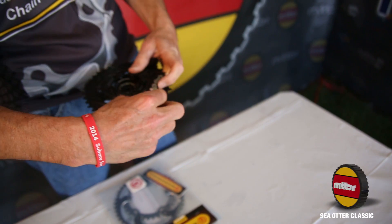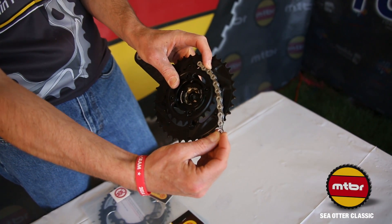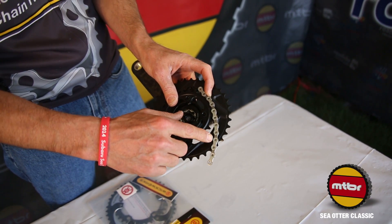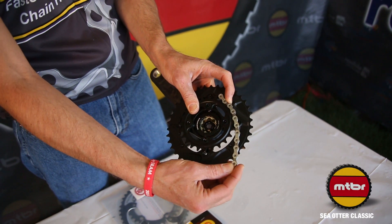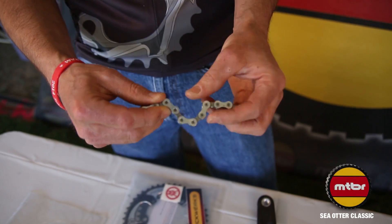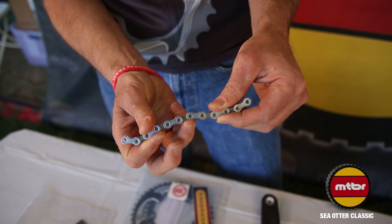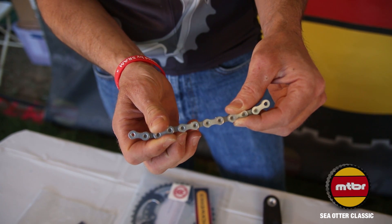Those ramps are designed with the intent to pick up the chain when you're ready to shift. So when you shift — say the chain is on the small ring — as the crank goes around, it picks up the chain on that ramp. It doesn't pick up at just one spot; it picks up at two different locations underneath the chain. So it's not like a single pin trying to catch it. We catch under what we call the load points. The chain is made of several links, each one solid, and each pin makes a joint. If you can pick the chain up under one of those joints — or in this case, under multiples of those joints — the chain is much more likely to stay on the shift ramp and therefore complete the shift.